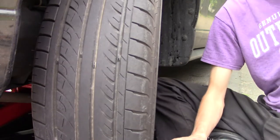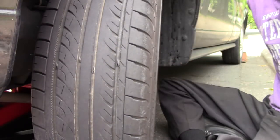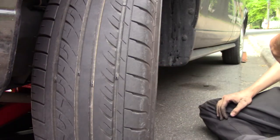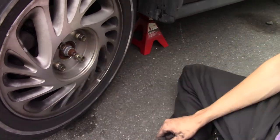And I'm not going to put the plastic cover on them because we want to retorque them, but I'm not going to retorque them because I don't have my torque stick with me, because it's off getting calibrated. But I want to leave it here so that I can at least recheck it with a breaker bar. Oh, you can't even see what I was doing. Just tighten the wheel down. But I'm leaving the cap off so I can go back and retighten it with a breaker bar.